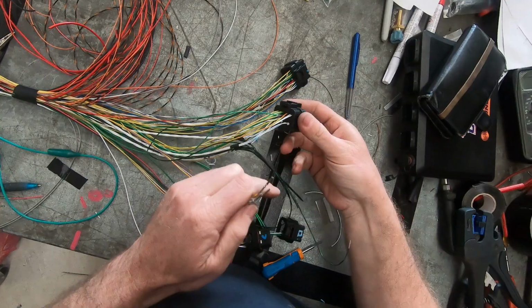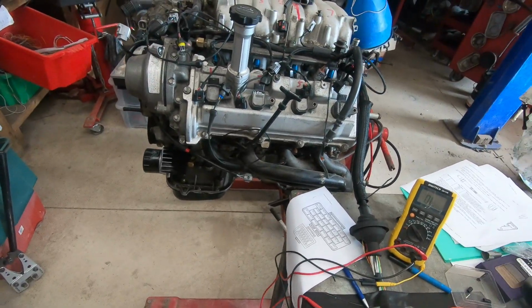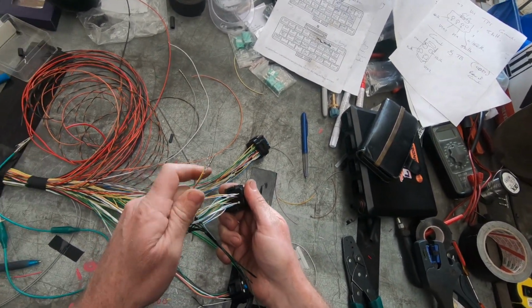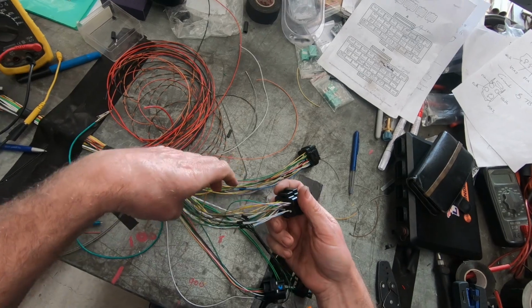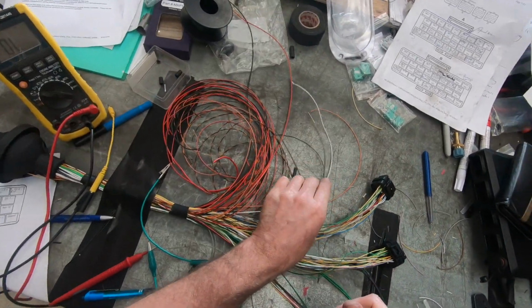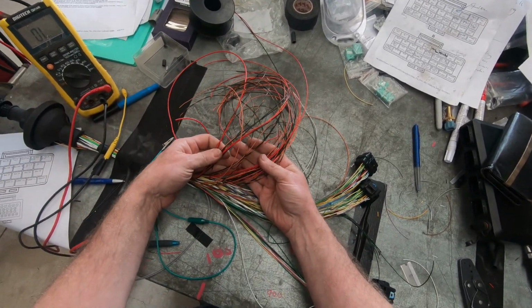The oil pressure and fuel pressure are both going into AN channels. Again, your choice of AN channels, it doesn't matter, providing they're calibrated correctly. And did you remember what colour we are? I didn't. Purple for oil, no, for fuel. Fuel pressure is number 7. Oil is brown, so I've got a brown coloured wire. And temp, a yellow-orange. Alternator, earths and 5 volts. Look at all these, and power supplies. Now that's going to be my next mission, is to sort all these out. There's still quite a lot of wires to do.